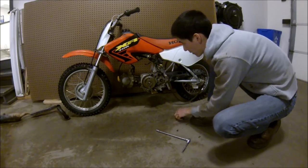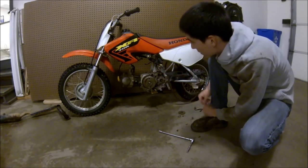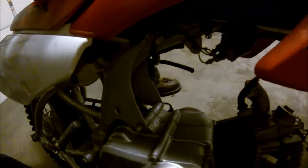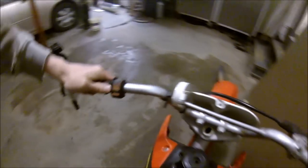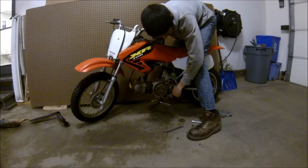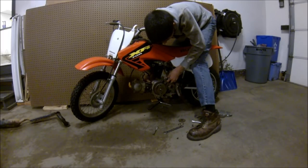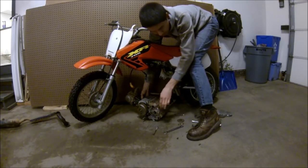Let's take that off and lay it all there. Now there's nothing to hold the motor on except for the two motor mount bolts — one back here in front of the swingarm pivot, one right on top. Also interesting is that the breather line — the crankcase vent — is disconnected. It's always interesting working on bikes that have been worked on by other people. We just wiggle the motor to get the rear bolts out, and out comes the motor.